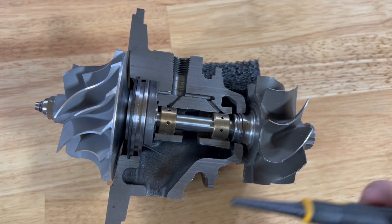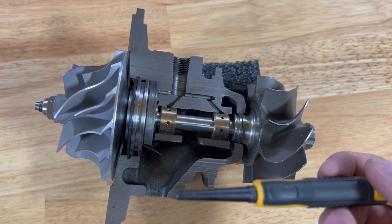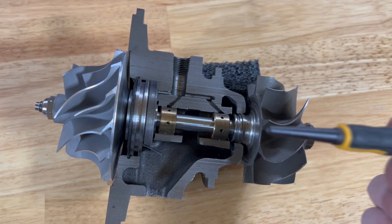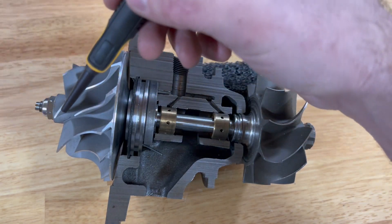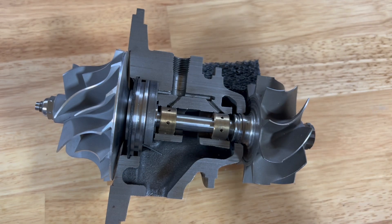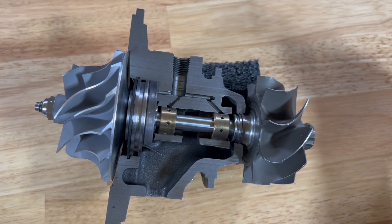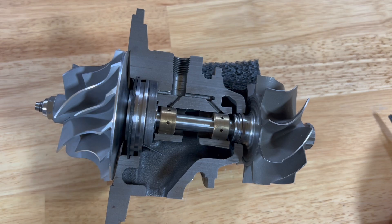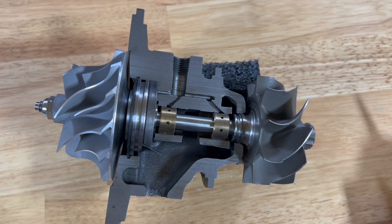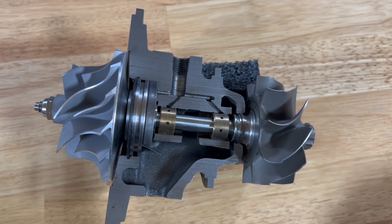You need to make sure your crankcase vent is venting properly. If you have a newer truck and have it rerouted to the atmosphere, make sure you remove your crankcase vent filter — that filter was intended to collect contaminants from the oil system before it enters the turbocharger intake. If you've vented to atmosphere, you're filtering for nothing. If the hose size is not adequate for the vent, you'll have a backup because air pressure can't flow through properly. And if the engine is worn out with excessive blow-by and the vent is obviously puking oil, it's going to push everything back up into the turbocharger and spew it out one or both seals.